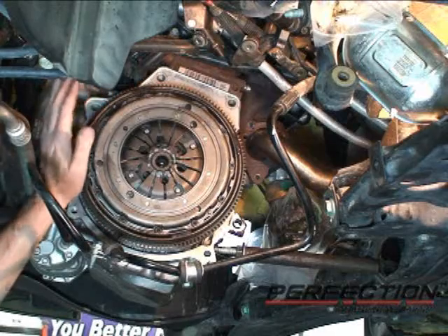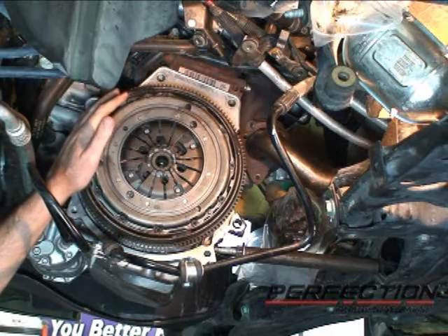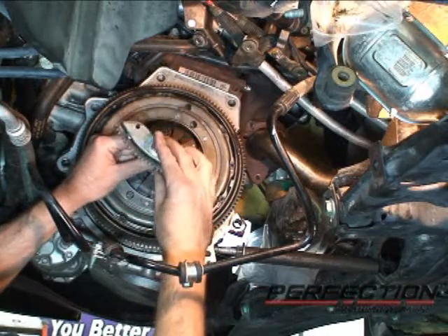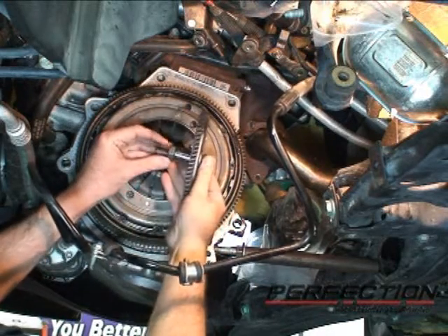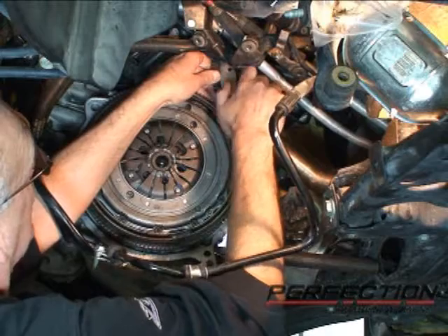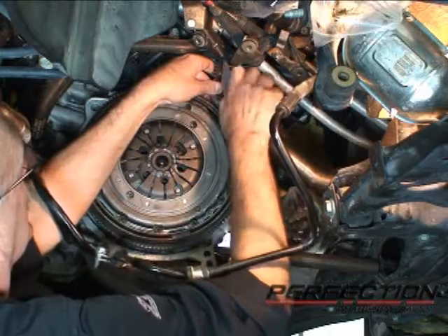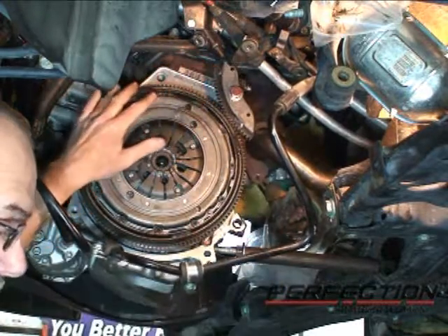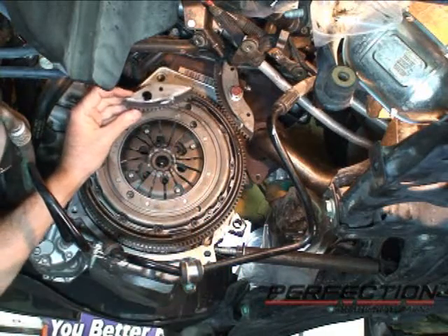During this servicing I'm going to have to hold this flywheel in position to remove the bolts and tighten the new flywheel in. I'm sure there's a service tool that does this somewhere, but I don't happen to have it. So I found a flex plate laying around, cut a section out of it, found the same size bolt, and just used a socket and a nut for a spacer. I thread that in, pick up the teeth, and give it a little snug. From a section of a flex plate, I've made a custom flywheel lock.